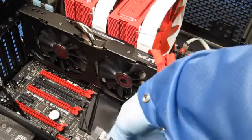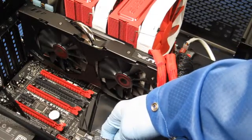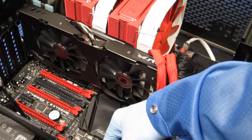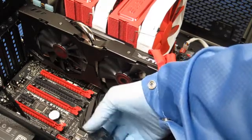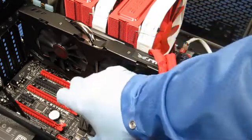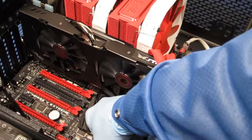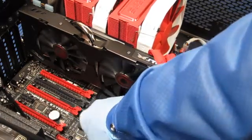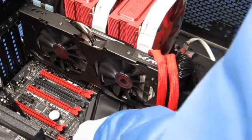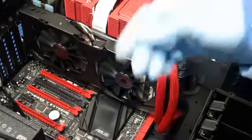I also ran all the chassis cables. The chassis comes with a little adapter where you can plug in the front panel switches — the power switch, reset switch, and hard disk LEDs — onto a little header. That little header just plugs in like this, which is very handy so you don't have to try to guide individual pins in. You can do it up in the air. That's really nice.